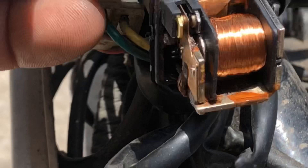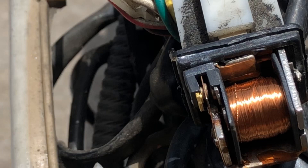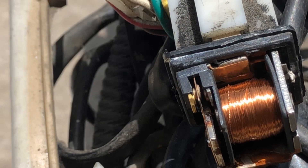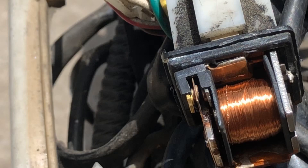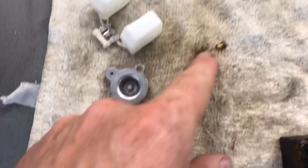At least it is to me - I'm hoping if you're watching this that it's interesting to you too. Now it's closing but we're not turning over - yeah, now it's not even closing. I think if I clean it a little bit more it will work. After testing it a couple times it does work. I applied some dielectric grease inside and then used some gasket sealer, put it back in there and sealed it up, so we'll let that sit. The carburetor's still cooking - I've run it probably four cycles so this will probably be the last one. I've already taken some of the bits and pieces out cleaning them up. We'll assemble that, put this back on, and see if we can't get this thing to start.